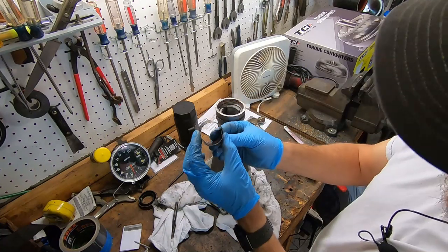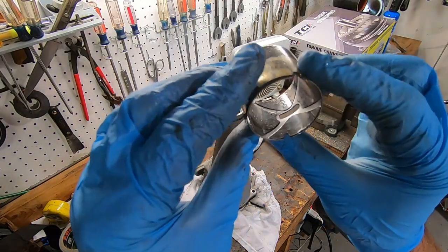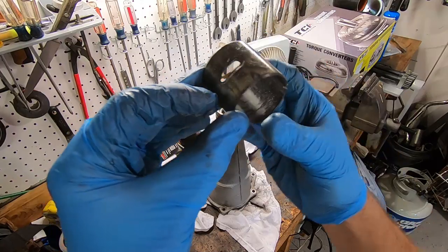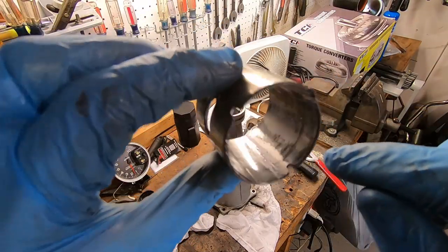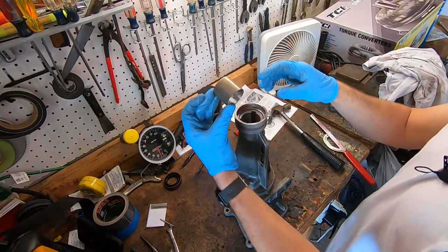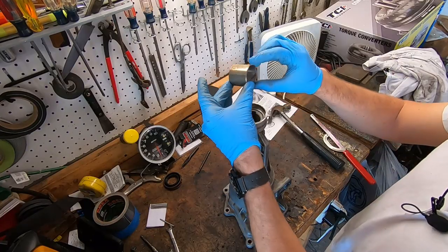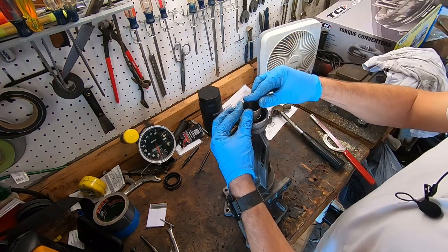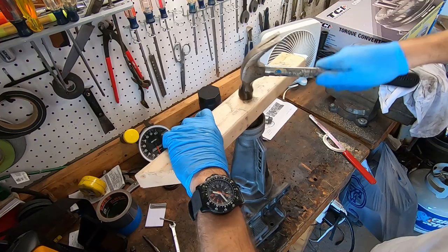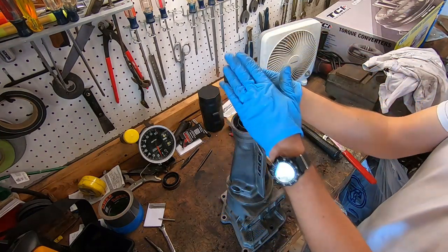There's the old one. Look inside of there — you can definitely see marks right there. See how it's ground smooth in spots? That right there causes driveshaft wobble. I put a little bit of transmission fluid on the new bushing. Make note of where the X was — this was at the bottom when I pulled it out, towards the bottom of the transmission, so I'm going to put it back in the same way. Put a little film of transmission fluid around it, center it, and drive it in halfway — that worked out about perfect.